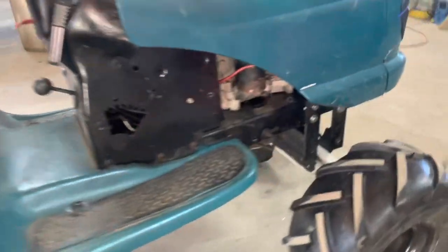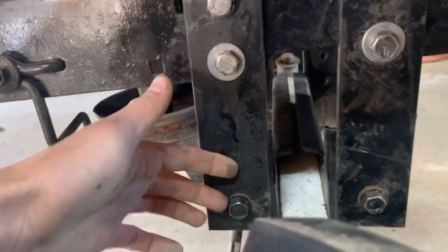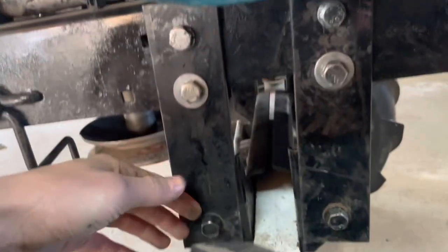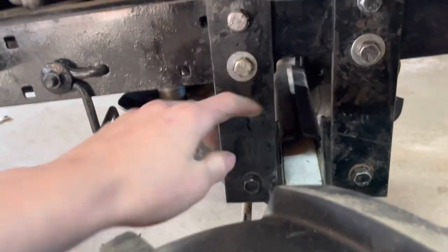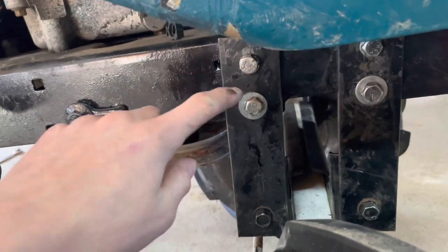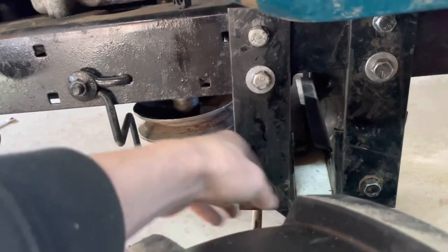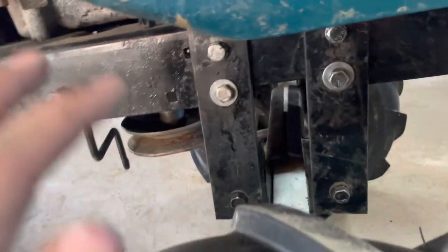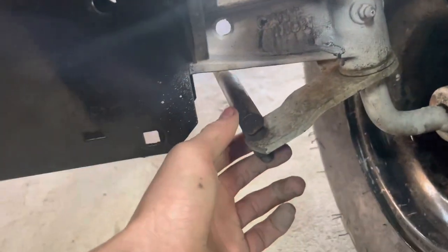Down here I'm going to try these out to get a little bit of extra clearance. And for the front — if you haven't seen how I did the lift — it's pretty simple. Just flat iron with two holes, and one hole on the bottom, and it's adjustable. I can make it an 8 inch total lift. Right now it's sitting at a 6 inch, I'm pretty sure. Obviously I can make it 4 or just take it off. It looks really good.